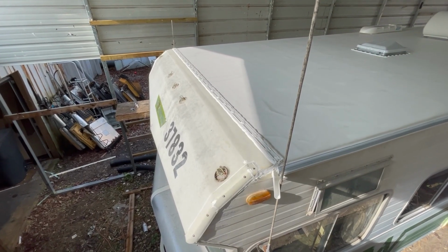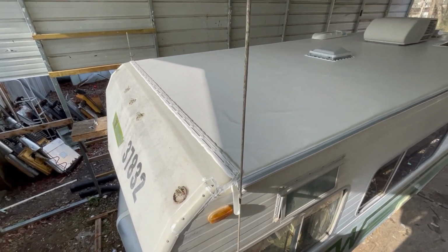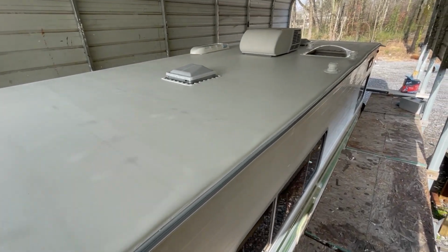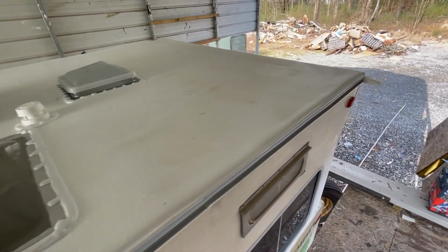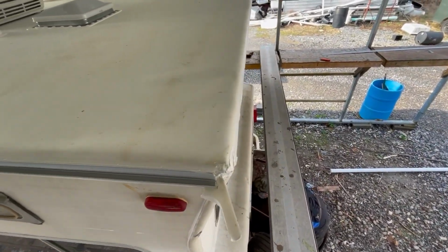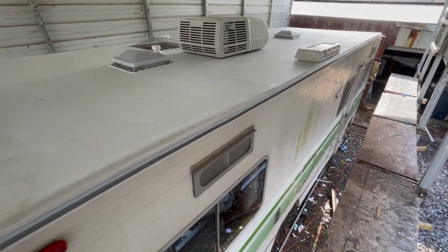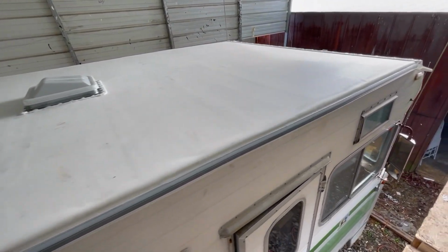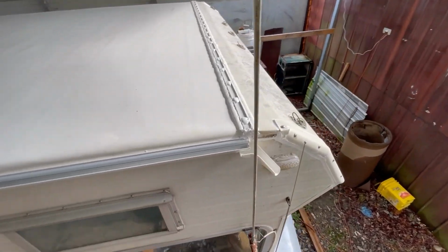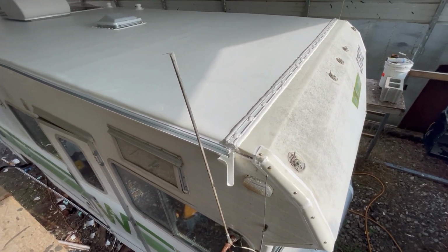Okay, well that pretty much finishes me up for the roof. I've got all the angles sealed, got all the corners sealed, turn bar up underneath the rail sealed. All the fixtures are sealed now, so that's pretty much watertight, other than those front lights on the front that I got to get in there. But everything else is sealed. Drip rails are on. Got the back all sealed and got it up underneath the bottom. So yeah, other than those lights, everything's sealed up on the front. Let's go inside and do one final walkthrough, and then we're gonna call it good on the roof.